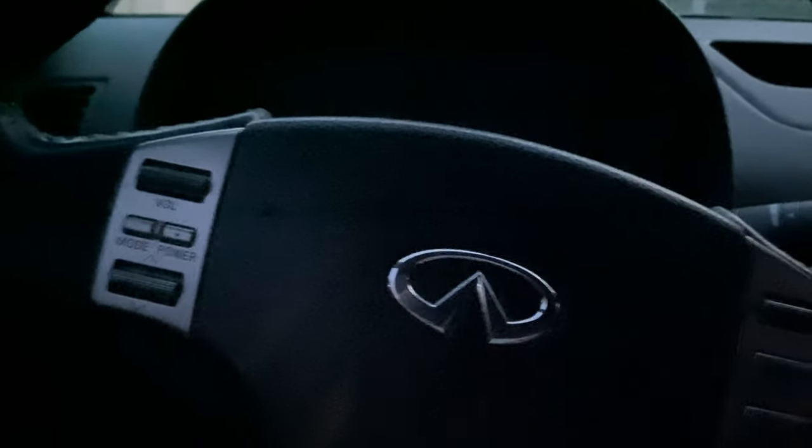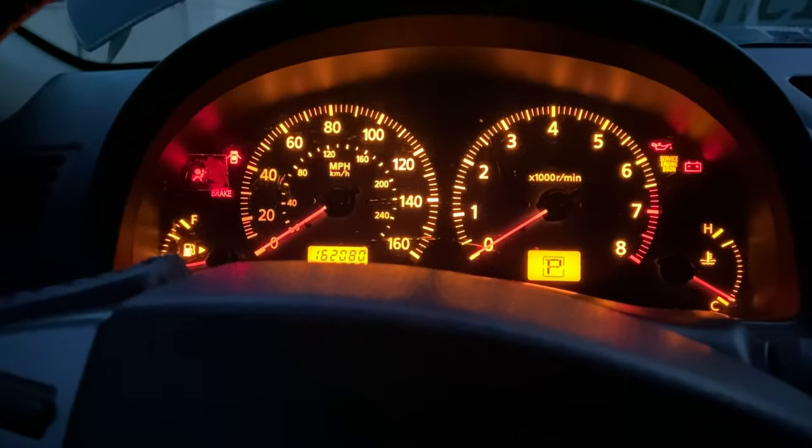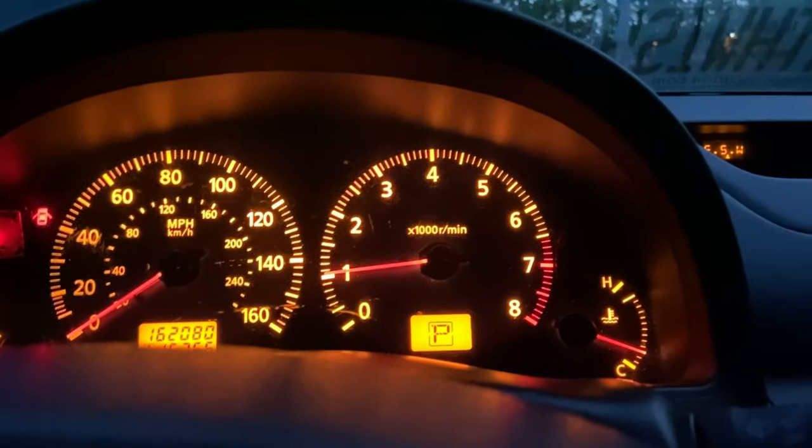Something quick to note: the oil pump is going to run the oil through the channel all around the system, into the filter housing, through the lines, and through the oil cooler. So there will be a dummy light on your dash when you turn it on. That light will be on for about half a second, and when it goes off that means the engine has been primed — you have oil pressure and all the oil has gone through the system through the main bearings and everything. You can see how the light went off — the engine is completely primed now.